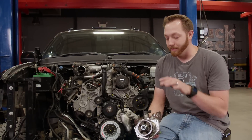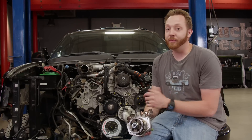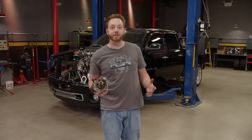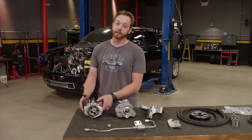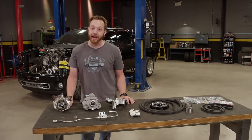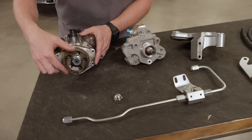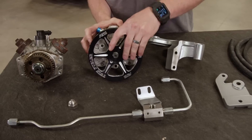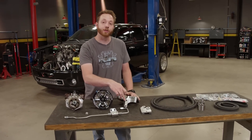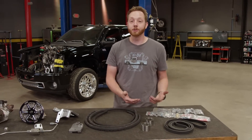The only other drawback is the maximum horsepower. This has a lower volume, even though it has a higher pressure than the CP3, and it will max out somewhere around 550 horses at the rear tires — and we want to make a whole lot more than that, which means we need some more high-pressure fuel. We all know that Summit Racing has a huge line of high-performance parts for gasoline engines, but they also have a pretty extensive line for diesels as well. That's where we picked up this ATS twin-fueler kit, which is going to add a second injection pump into the mix — a CP3. Whether you have a factory CP4 or a CP3 in the valley, it's driven by the camshaft gear. However, our second pump is going to be driven by the serpentine belt. The kit comes with all the necessary brackets and high-pressure fuel lines to complete the installation, and this is going to plumb into the back of the driver's side fuel rail. You also get the low-pressure fuel line, the pulleys, the belt, and the fittings needed to round out the installation.